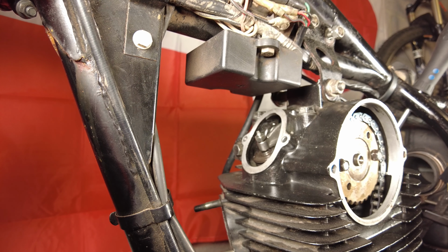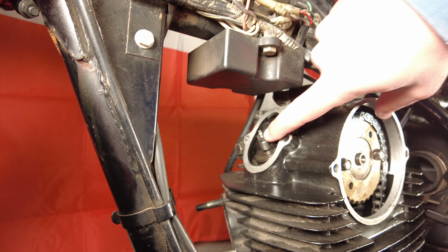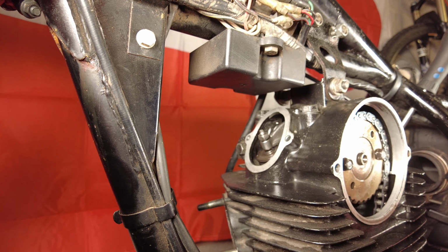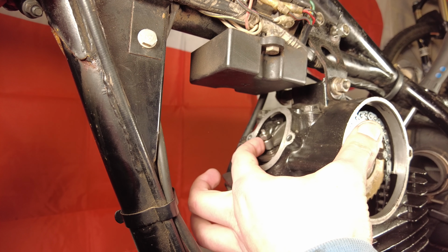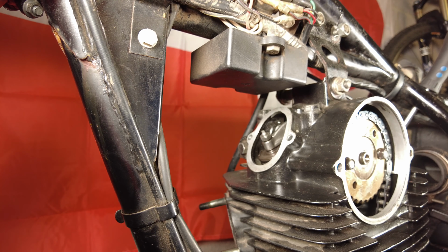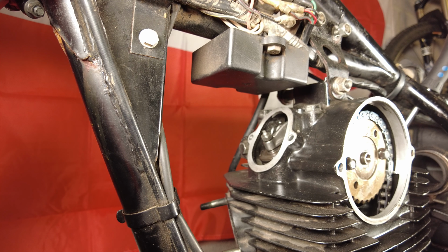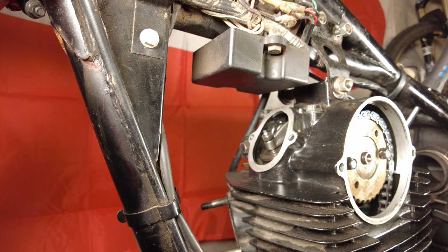Right, so the next step is to correct the valve clearance. So on the exhaust side at the front here, got quite a bit of movement here. When the engine's at top dead center and nice and cold, obviously things expand as they get hot, there should be a certain gap there. So within a certain tolerance, that should be okay. Same for the intake. Typically the exhaust has a bit higher tolerance because it gets a lot hotter, and so it expands more. That means that if your clearance is too tight, then things don't open properly and things can drag a bit and all that sort of thing. Typically a too big clearance isn't so bad, it's just a bit more tappy, a bit louder.